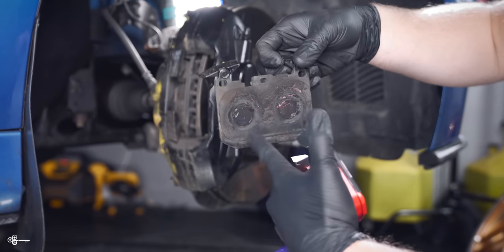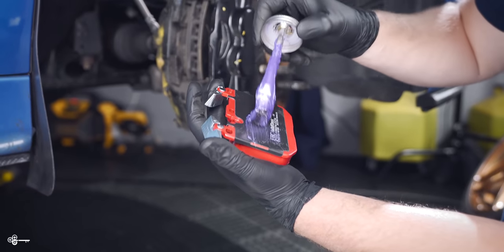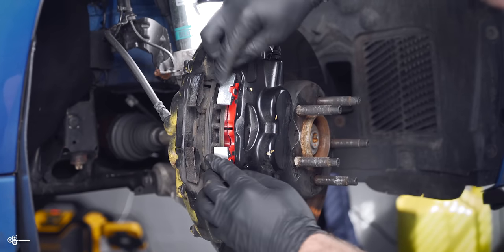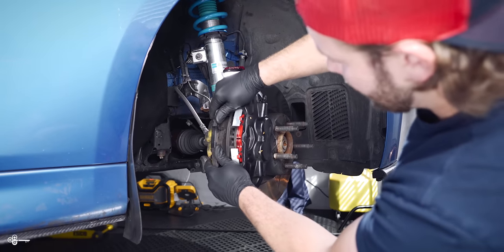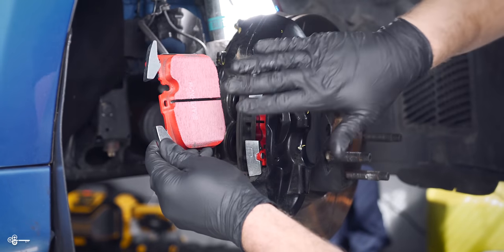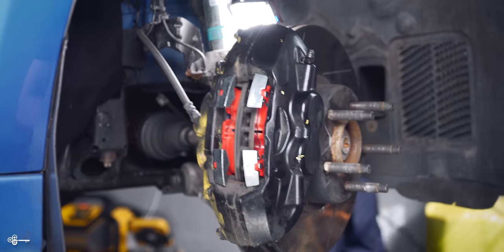I have some ceramic brake paste, so I'm going to put a very small amount in the back. The area that we're aiming for are right here — there's a little circle here for the piston and then another circle over there. I'm going to try to aim for that general location on the back of our new pad. Then you can take your new brake pad and carefully slide it in like so. Then you can do the exact same thing to the other side — compress the piston, slide it out. When you're doing this, always be very careful not to get any of the lubricant on the actual brake pad itself, only that little section in the back. So once you've done that, you can put that in.